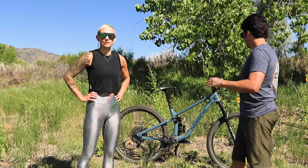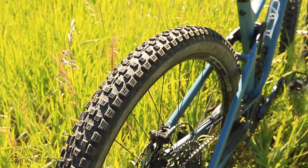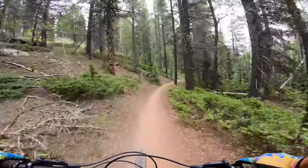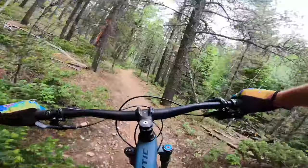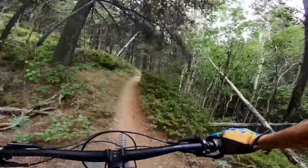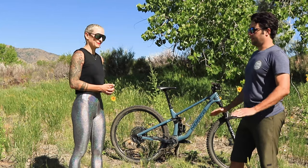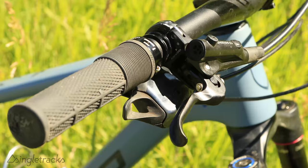Talking about the build kit — it's spec'd really well overall. The front tire is the Mazza and the rear is the Martello. On hard, smooth cornering and jumping surfaces the tires roll fast with no traction issues, but in loose corners with rocks and roots the Martello gave me less confidence — it was sliding a lot. Also, I'd happily swap the reservoir Super Deluxe Ultimate rear shock for a simpler inline shock, save some money, and put it toward better brakes — the extra stopping power would be worthwhile.